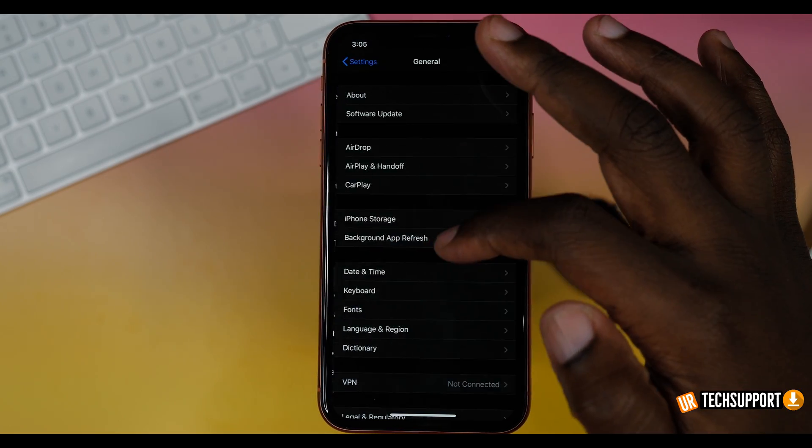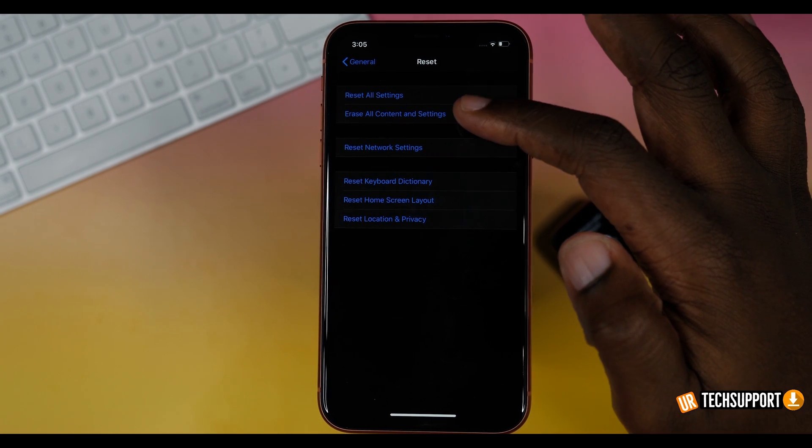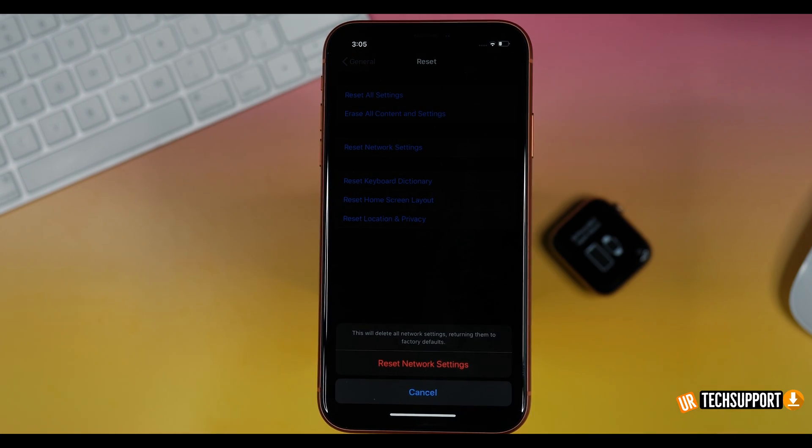Another great trick: if you're running into connection issues — not just with Apple Watch but any connection issues — go into Settings, General Settings, and reset your Network Settings. This clears out any stale or cached information on your iPhone and can fix a lot of connection issues. I had an issue connecting an Apple Watch recently, cleared out the network settings, rebooted the phone, tried to connect again, and it went through no problem. This is your secret weapon if your phone is compatible and up to date but still having connection issues.